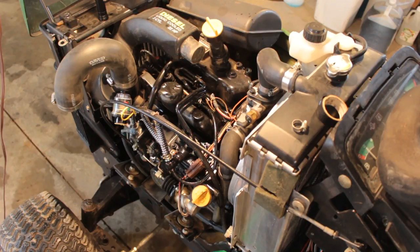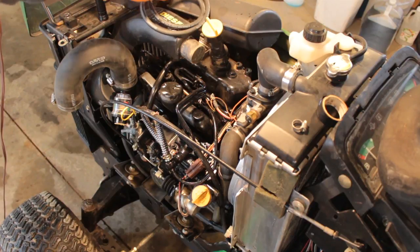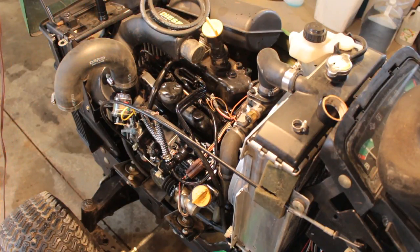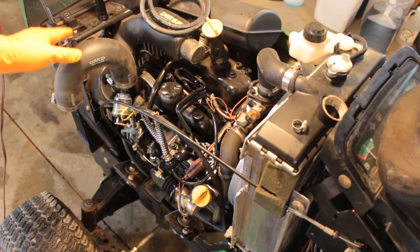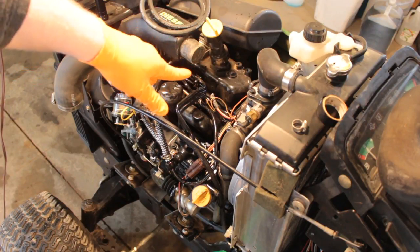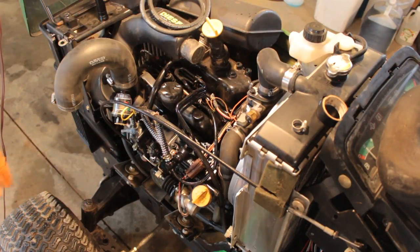It's actually a pretty easy repair. I think one of the biggest misconceptions with diesel machines is that they're hard to work on. Because they don't have a big electrical system like gas machines, it actually makes them almost easier to work on. I think sometimes people just get a little scared because they're different than a gas engine. So I'm going to go ahead and spray out the top of the engine, get the air cleaner hooked back up to the intake. Then I'm probably going to take the front clip off and go ahead and replace the valve cover — take the muffler off, replace the valve cover gasket or o-ring, and also check the valve lash since I'm sure that hasn't been done in a long time. That'll be on the next video.